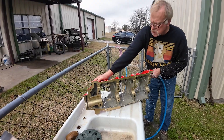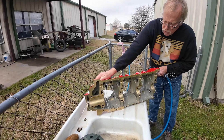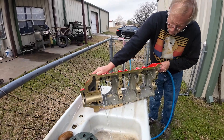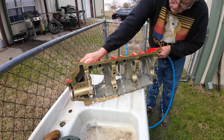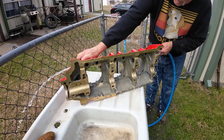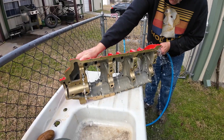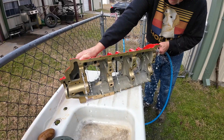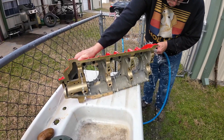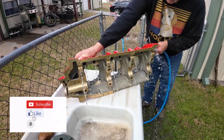You've also got some oil going out the front, and that'll be going toward your governor and all that. So this is kind of what's in your high pressure oil circuit — this is how your engine gets lubricated. In addition, your cam bearings up here are also in the circuit, and this circuit crosses over to the other side to give you even oiling. So that's what it looks like when it's running — there's just a torrent of oil going through the engine and lubricating it.